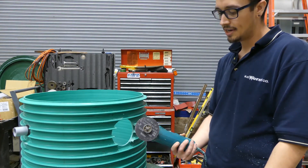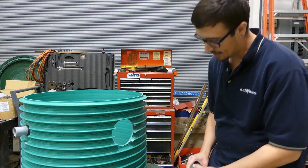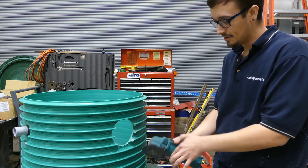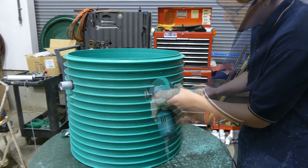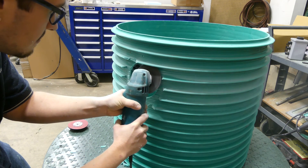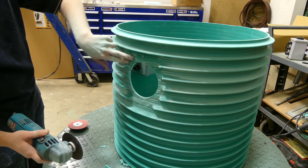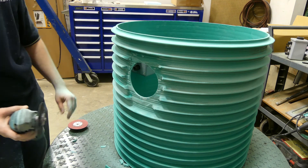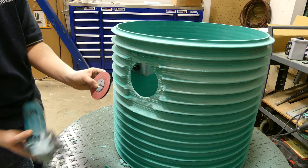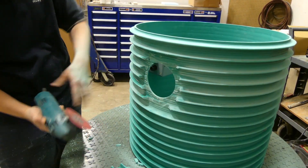Now we've got our grinder here and we're going to go ahead and cut these ribs back so that we have a nice flat surface for that gasket to seat down on. Be mindful not to mess up the hole up top. I took the cutter, went in at an angle, worked my way around, and knocked those pieces out. Since it is curved it can be a little bit of a challenge. Now we're going to put the sanding disc on our wheel and smooth all this out so we have a nice spot for that gasket.